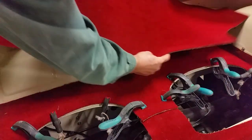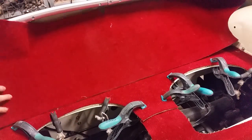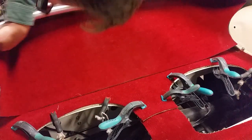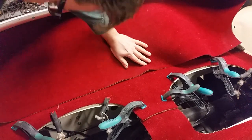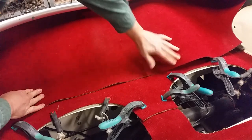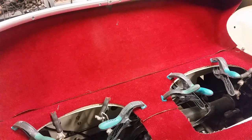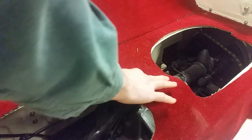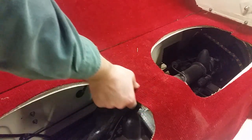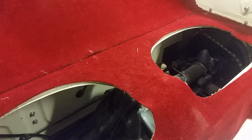With that in place, we're going to put this one in place. It's going to take some trimming and fitting to get it to pop up just straight. There you can see the seams — they look really good. It'll be nearly invisible when the seats get put in place. I still need to trim around here because this is too long, and there's a weather stripping that goes in there before the seat gets put in. We don't want the carpet in the way of that because it'll get wet and just soak in water.